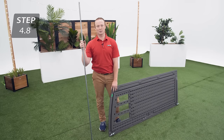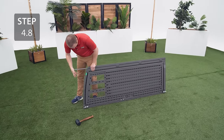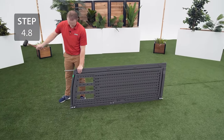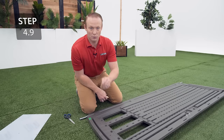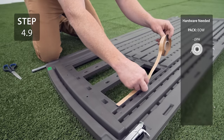Place the hinge tube into the top of the door until a few inches hangs out. On the back of the door you'll see a groove around the window. Insert the butyl tape into the groove all the way around the window.